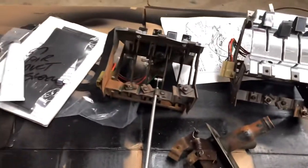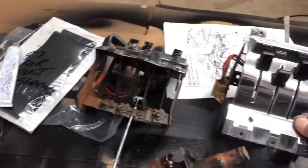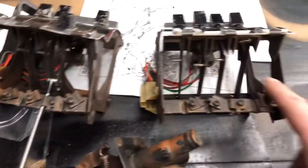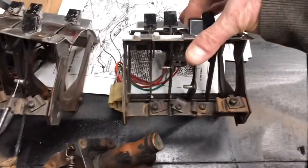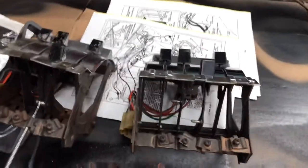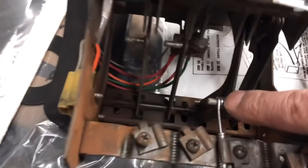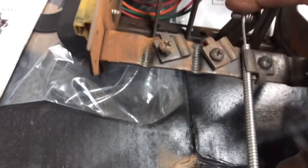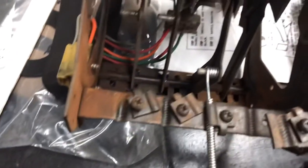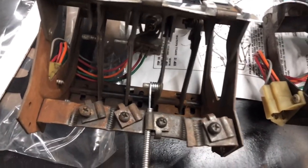What I'm going to finish doing later is put the control box back into the car, hook the cables to each one of the different levers — the cables go through here, you tighten down these holes, and then you can control your vents and open and close them as needed. One other thing to note: on the end where your control switches are, these could come off if your cables bind at all. There's a small round disc that goes on here to hold the cable — you should buy those too if you're going to redo your cable system.